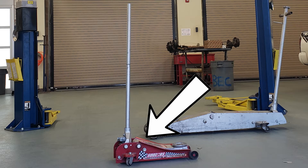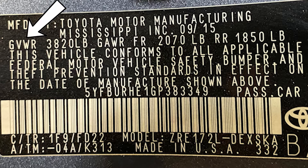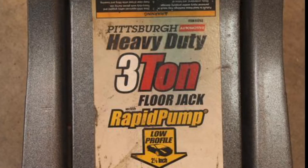Next we have a floor hydraulic jack. There are several types such as low profile and heavy duty, that can span weight limits of one ton to over four tons. These are great for lifting vehicles in your own garage or outside of the shop. If you are questioning whether or not your equipment can support your vehicle, you can look on the door jamb for the vehicle safety certificate label. Under GVWR, or gross vehicle weight rating, you will see the total weight — in this case 3,820 pounds — which is well below our lifting equipment's weight limit, so we can continue.